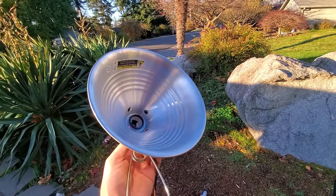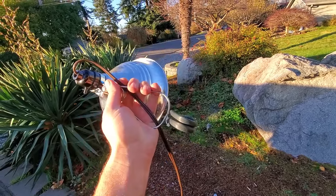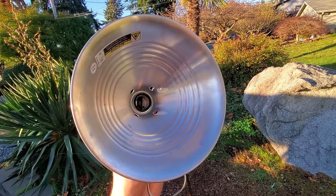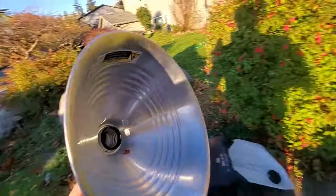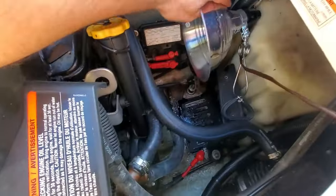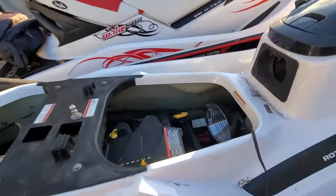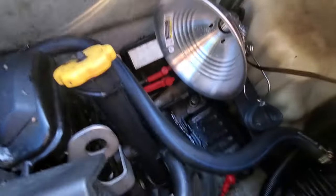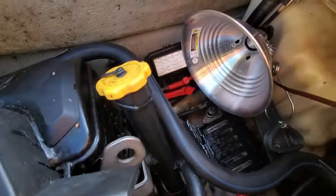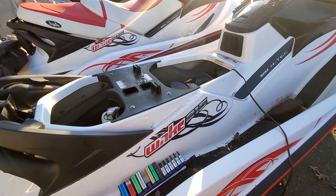One more little tip that I've always done: get yourself a little heat lamp — you can buy these from Harbor Freight for about five bucks or on Amazon. Clip it on with a 60-watt incandescent light bulb, not an LED that doesn't put out heat — you want an old school regular light bulb. Clamp it inside somewhere where it's not making contact, right around the engine bay. When you have your cover on all season, 60 watts puts out a little bit of heat and keeps moisture away. You can see moisture collecting in there just from sitting — it collects everywhere in the engine bay. Having that little 60-watt bulb running with the seat on really does help; when you open it up, it's dry and happy.